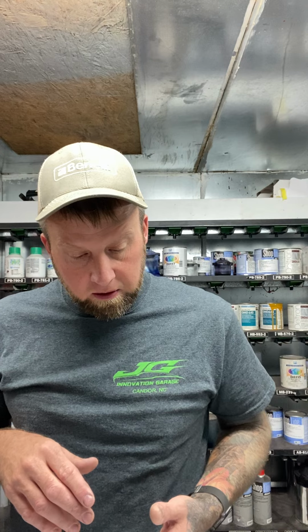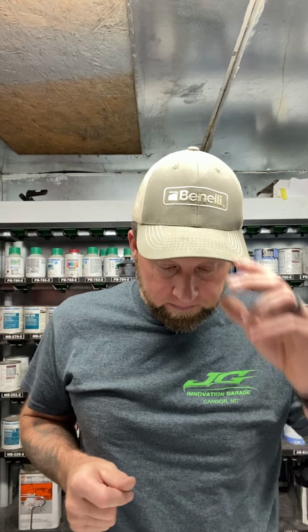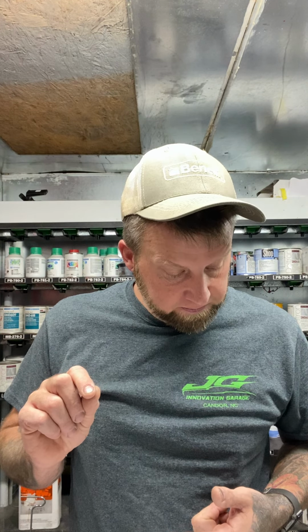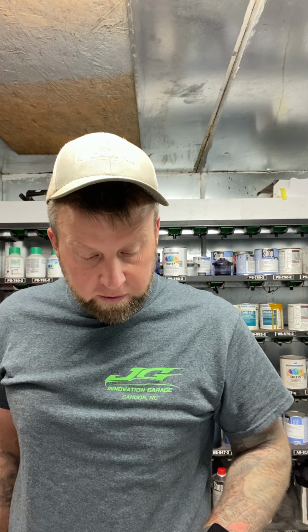Sandblasting, the pros. It's actually very fine sand. It's not sand, it's like crushed glass. It almost looks like beach sand. The pros: it gets in the pits after the paint is stripped. Best for frames and heavy gauge metal. The method is also perfect for spot blasting.